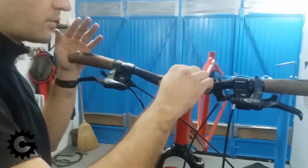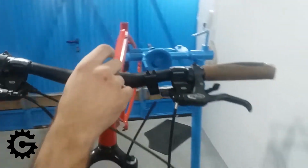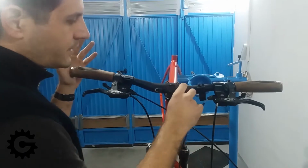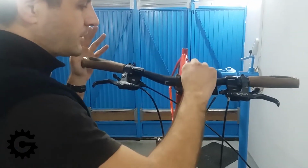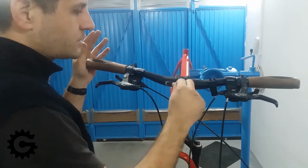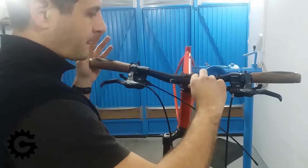And here, from my experience, when I hold the Allen key halfway through, it usually does not exceed the needed torque for the bolt size that the Allen key is used for, but it is safest to use, of course, a torque wrench. Here you can see the diagonal pattern of tightening: top left, then the bottom right,